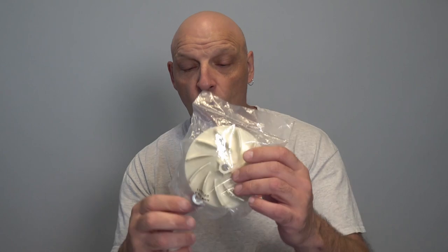As well as that, you're going to need a new fan. Now, the fans you can buy are identical for the G series and the Legend 2. The only difference is the spindle is a little bit longer, so you can't use a generation one. You can use the fan, but not the spindle. Also, you'll notice in the packet you've got a little rubber seal. So you know you've got the wrong one because you'll have a little rubber seal in the packet, and that will be for a generation. For the Legend 2, all you get is the spindle, a washer, your little grease cup for your front bearing, and your fan. So this is the one you require, and there will be a link in the description below of where to get these from.